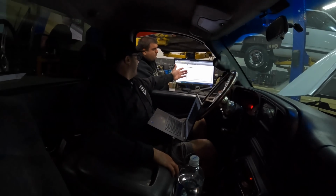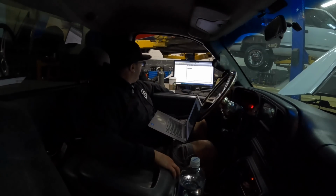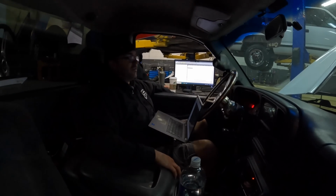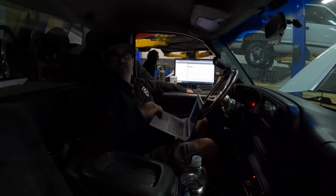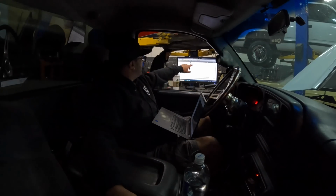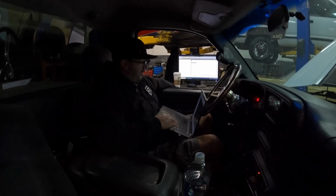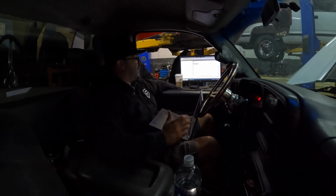But that's why your truck doesn't feel fast, because you're down 100 horsepower. I mean, you're at 530 at 4,500, and it never goes up from 4,700 RPMs. It just completely flatlines. Yeah, for sure. No way the engine could do that, you know what I'm saying? The engine is either gonna nosedive, or continue up, or go flat. But it's not gonna add and remove power. It's not boost. Boost is flat. Timing is flat, and air fuel is flat. So there's nothing that is gonna cause that type of change under full load.